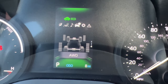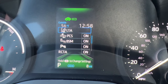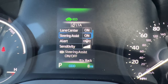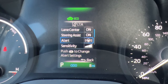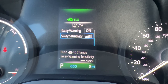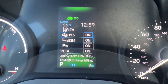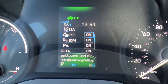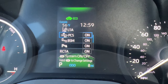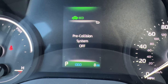In the settings chapter of the mid, I can do some advanced configuration. For lane trace assist, if I push and hold OK I can turn 'keep lane center' on or off, turn off the steering assist that pushes you back in your lane, change the vibrational alert sensitivity, and change the sway warning sensitivity for when it senses you're drowsy. For the pre-collision system — which alerts you with a bright orange and white brake symbol and will start stopping for you if you don't brake — I can change the sensitivity or turn it on and off, though turning it off gives a yellow warning symbol.